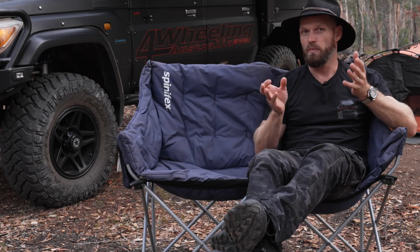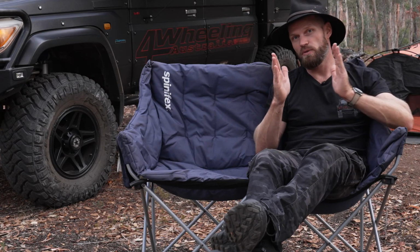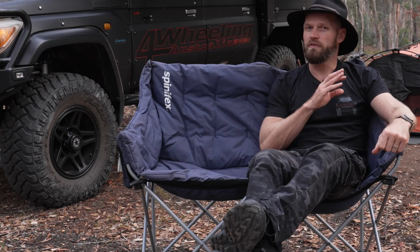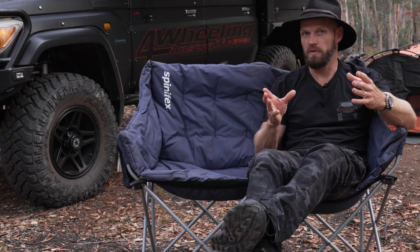If you're going to carry a lot of weight, which I'm not, but if I was, then I probably would consider stretching it, because where the axle is at the moment is too close to the cab. There's too much tray overhanging the back. But the way I've set mine up, that's not a problem. Half canopy, not a problem. But if you put a full canopy on a 79 series, you are probably going to want to stretch it if you want it to drive properly.